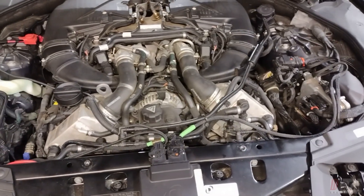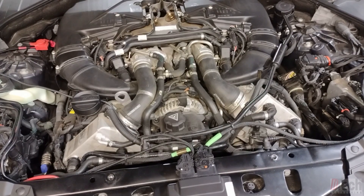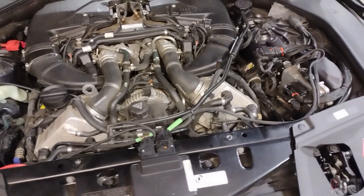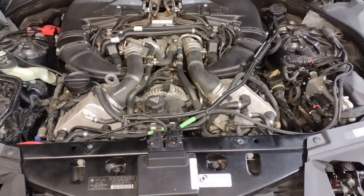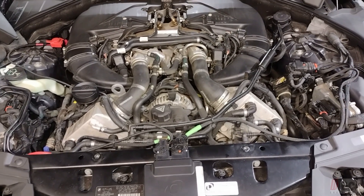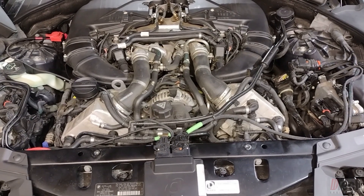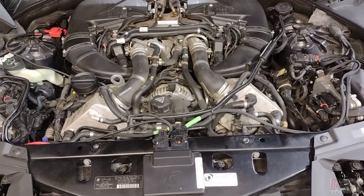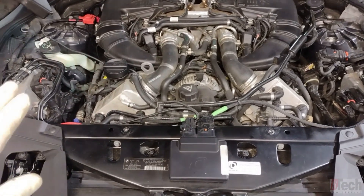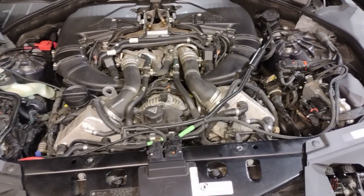Being that it's performance-oriented, I'm assuming it's going to try to steal and manipulate signals to the DMEs. Since all those sensors on bank one and bank two are basically shorted to ground — on both banks — on exactly the sensors this module would intercept, I'm simply going to unplug the jumper harness from both DMEs and recheck the codes.